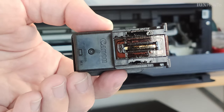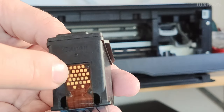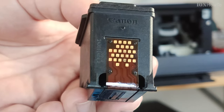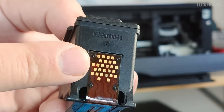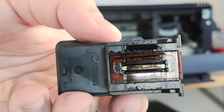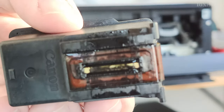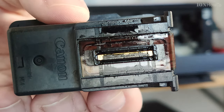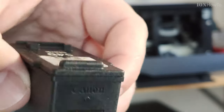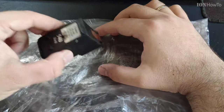You can see it's pretty dirty here — it wasn't used in a while and the ink gets dry on the cartridge. A problem could also be a burned contact, and when that happens there is not much to do other than replacing the cartridge. But there is a possibility that it's just blocked ink, which is relatively easy to fix depending on how bad it is.